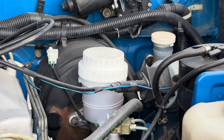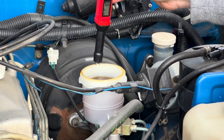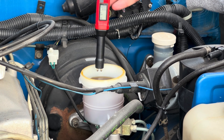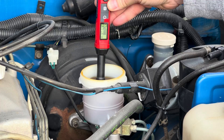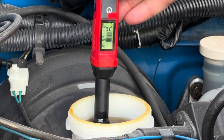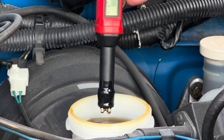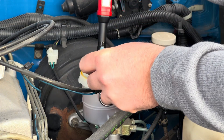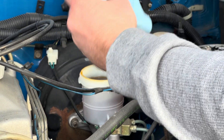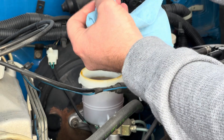We'll go ahead and start this back up again. This unit has not had its fluid tested or even changed since I purchased it — I've had this vehicle for probably 8-plus years and I don't know if anyone's ever done anything to the fluid, maybe just topped it off. Let's go ahead and test it and see what it comes in at. All right — 2.5, 2.6. I'm actually surprised; I was expecting much worse out of this system. It's in the middle, obviously not great, but definitely acceptable. It's always worth noting, between tests or between vehicles, do thoroughly clean off the end — you don't want to mix those chemicals or leave them on to cause any potential corrosion. Give it a good cleaning and wipe it off to make sure none of that residual stays on there.